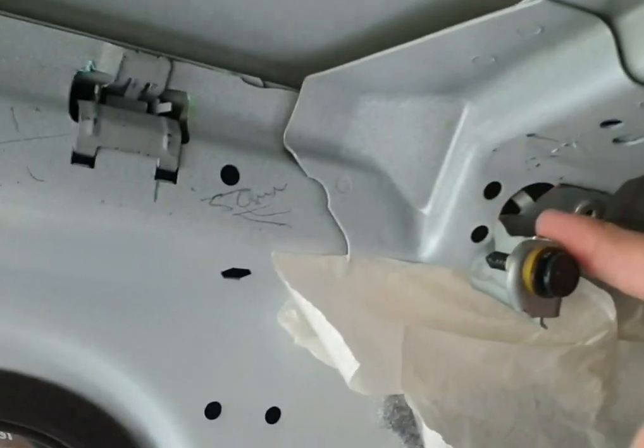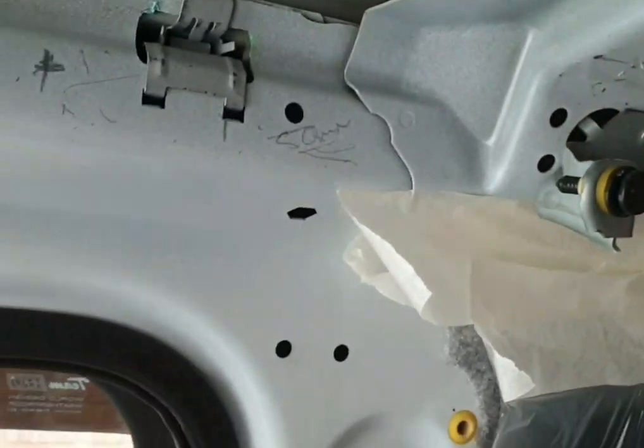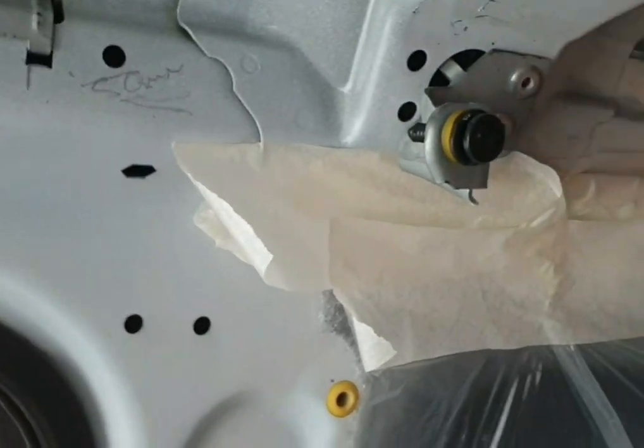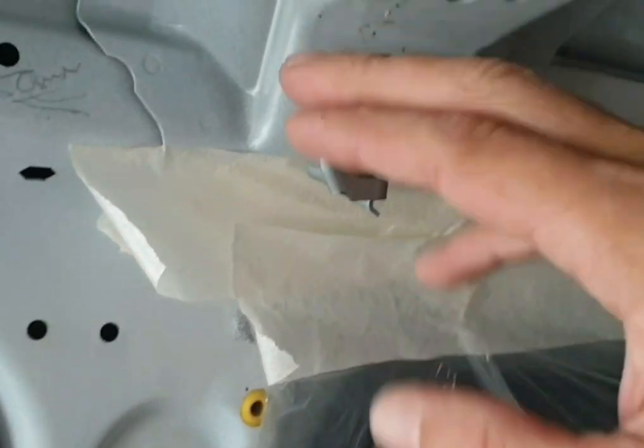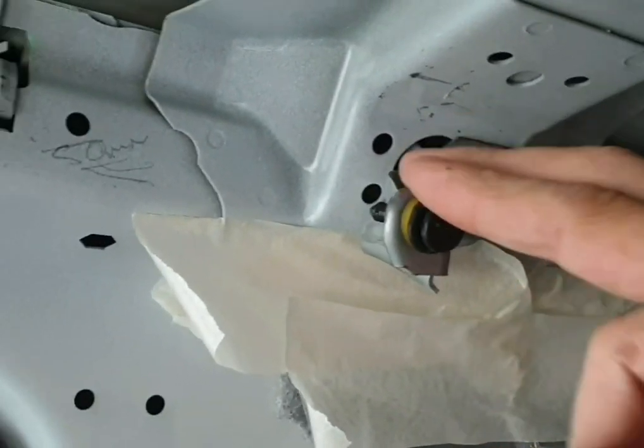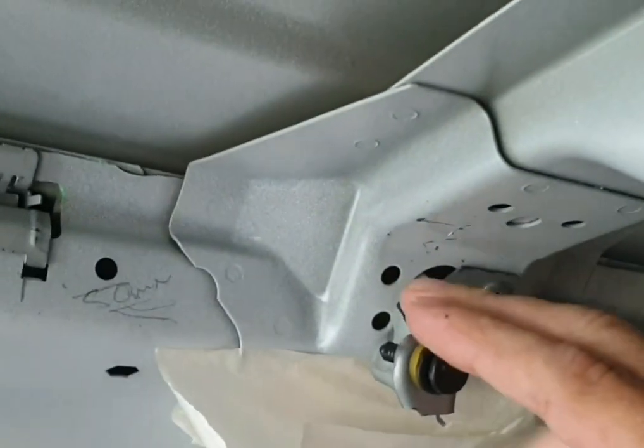Also, we've knocked this one down a bit. We've got a strengthening bar, so when we take these out, we put a new bar in, go another way along the van. So this comes out because it needs to sit in here. Well, we just knocked it down a bit. Some people take them out, but I thought it's pointless. Just knock it down a little bit. The opposite side's slightly different where the sliding door is.